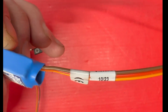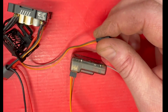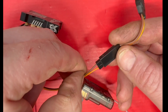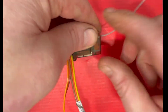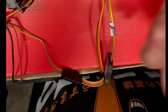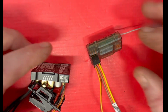This BEC has to have straight power and ground. Make sure you plug this into your auxiliary and then plug this into your throttle. You're probably wondering: does the B-link work? Yes, it does. Once you're done with that, the B-link will work. Brown is always ground — brown is ground on everything. Hook the B-link up to your throttle, take your little computer device and program it. Install it — kosher pickles, you got it.